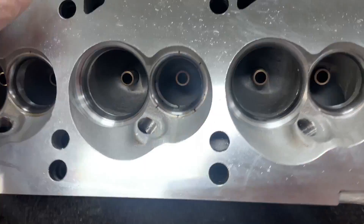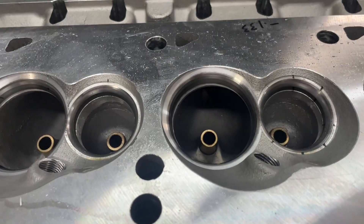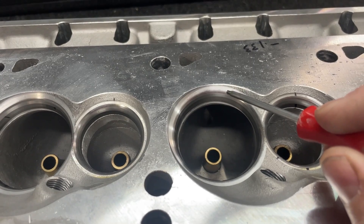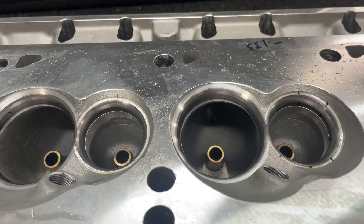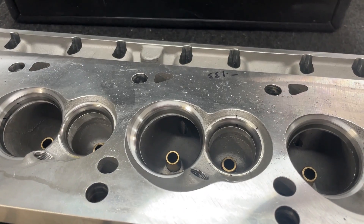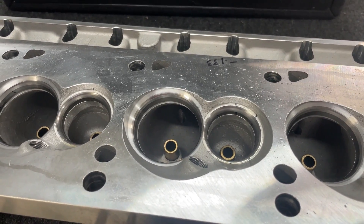We can mill those back, and I don't think it's going to hurt anything. If you look at how much of a ledge it is, the top cut is really in this range, so I can probably mill around 20 thousandths down, which would be almost three cc's. I don't think I'm taking out three cc's to get it right.